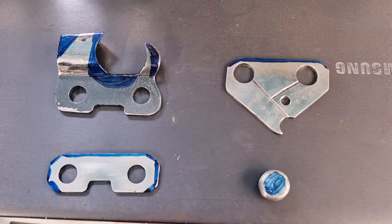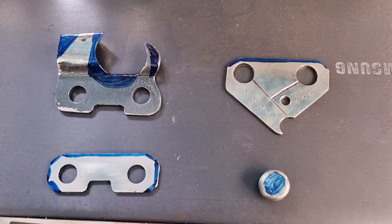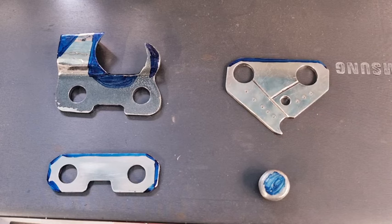I'm going to talk about those racing chains because if you have a better understanding of chainsaw tooth geometry, you'll have a better understanding of how it works and how it gets rid of the chips. We can talk about narrow kerfs — that's always been a point of discussion. I don't like narrow kerf chains because they're only for small saws as far as I'm concerned. They have their place. Some professional saws like the MS 260 or something like that have a slightly narrower kerf, and a slightly narrower kerf is okay.